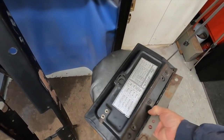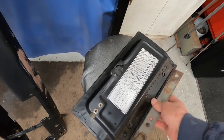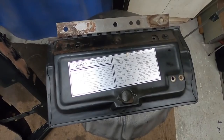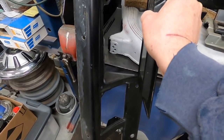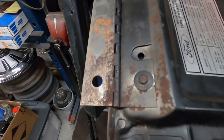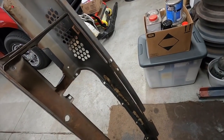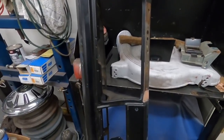I'm going to mask this off in here because I want to keep the original tire inflation sticker. Going down an assembly line, the person working that day probably didn't really care how straight those stickers were. This was assembled pre-painted - you can see no paint there - so we're going to sand that and get it painted. I might take the hinge right off and paint it separately, and definitely paint the back side of the panel. It's just minor surface rust - for the age of the car, wow, it's in good shape.